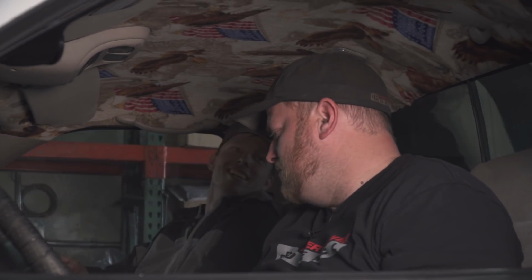Science. Okay, this is back to caveman stuff. Now, we should do one more full power run with no sauce, so we have a baseline on what it added. So now we're going to do a back-to-back run with no injectables turned on, because the wastegate's creeping down. I don't know if it's burning the turbine wheel or if the spring's relaxing or if this engine's going away. All we know is we're slowly losing power as we're going. So we want to do a fuel-only run now to really quantify what the injectable gain is with the nitro and the methanol mixed.